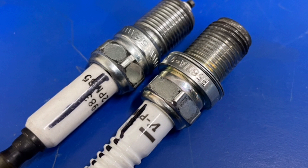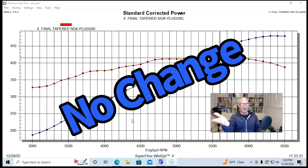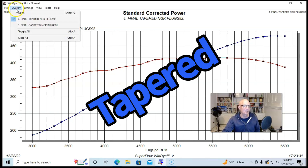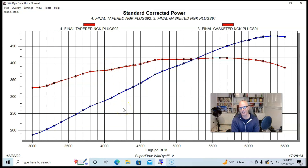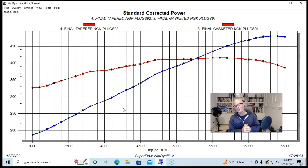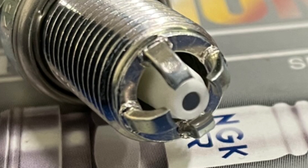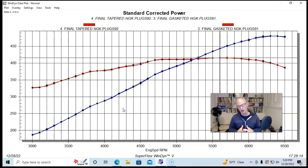Both plugs were run with the same gap. One was gasketed, one was tapered seat. As we've come to expect on many of these spark plug tests, there really was hardly any difference at all. This is the power curve from the tapered seat plug, and here is the power curve from the gasketed plug. In a direct back-to-back test, the difference is like one horsepower or less. They're basically just overlays. Even if the tapered seat plug protrudes farther into the chamber, you can argue about changing static compression or changing the initiation point of ignition, but the reality is — like we found with a lot of other plug tests — it doesn't make a meaningful difference. I've tested the E3 spark plug, laser platinums versus cheap AutoLite copper plugs, indexing — we've done a lot of different spark plug tests, and so far I really haven't seen any power difference.